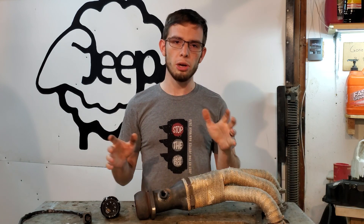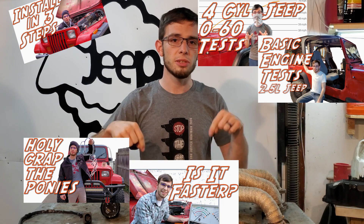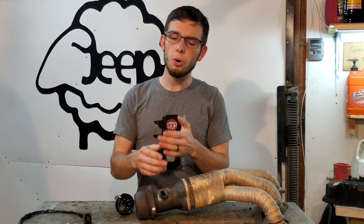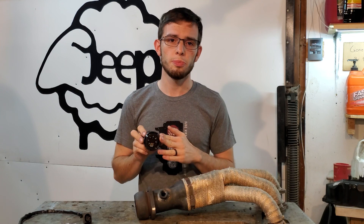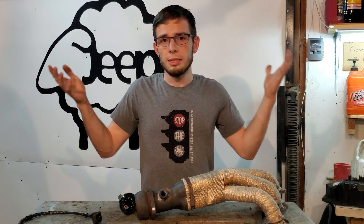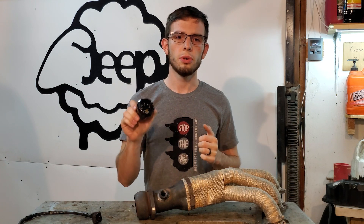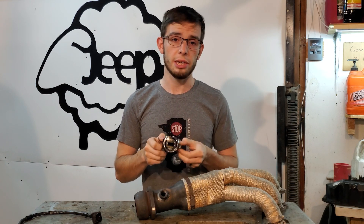Then I can continue trying to tune my engine with the Power Commander 3. If you haven't seen videos on what the Power Commander 3 is, you can find them — the link's definitely in the description. This install is going to be relatively easy. It does involve welding a bunghole, or repurposing your existing one, and then the rest is purely just wiring to get the signal to this display. I'm not doing the version where I'm using this O2 sensor to feed my engine's computer data, so if that's something you're looking to do, this video is not going to help you. This is adding an additional O2 sensor so you can read your air-fuel ratio in a very accurate way.